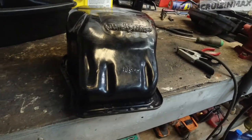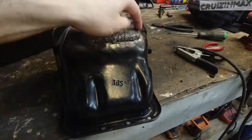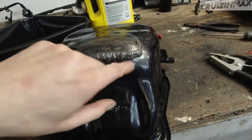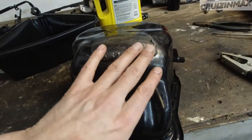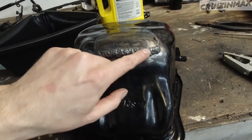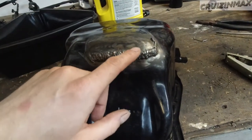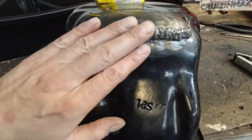Update: no plate, just welds. Build up — kind of started from this side, still adjusting the welder, and then kind of spot welding. Not like a constant weld but touch and then wait for one second, let that one weld cool down, then touch again next to it. Just keep going — spot spot spot spot spot. Because if you keep going and this is thin metal, you just melt it. That's how it looks outside; I'm obviously going to clean this up to a smoother surface.